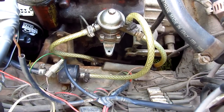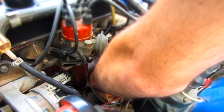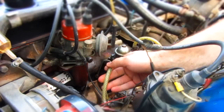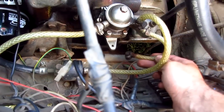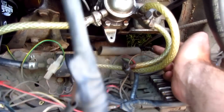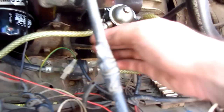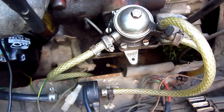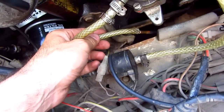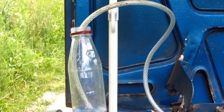The fuel has to be shut off when the car is not working on gasoline. Only the two hoses on the left and right side will be changed. I undo the lower part of the hose and take all of these hoses off. This hose was on the pipe which returns the fuel to the reservoir — that's the return line. And this was on the left side on the metallic pipe that sucks the fuel out from the original tank.